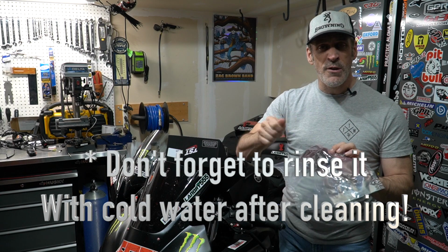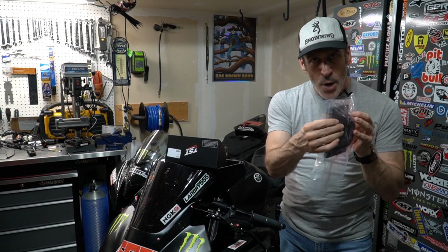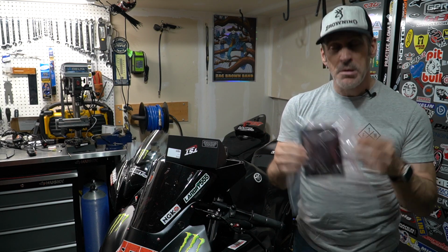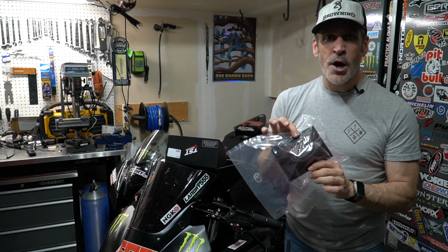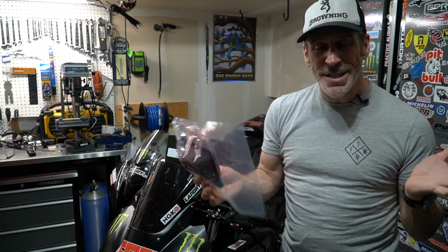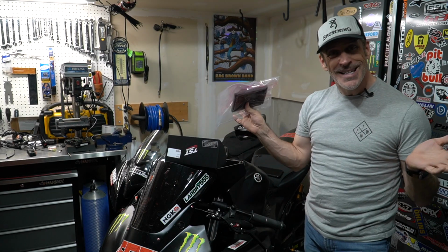After that, I take some WD-40, spray it on top and underneath, just press on that sponge, let the WD-40 be absorbed from that sponge. After that, I just take a paper towel and remove the excess, and that's how I oil my filter. You don't have to do it this way. Obviously, you can follow the process that MWR is recommending in the little user guide or on their website. So you do what you want. That process seems to be working well for me, and it's a fraction of the price.